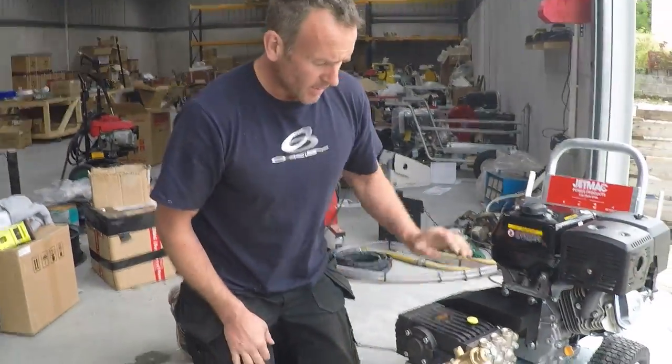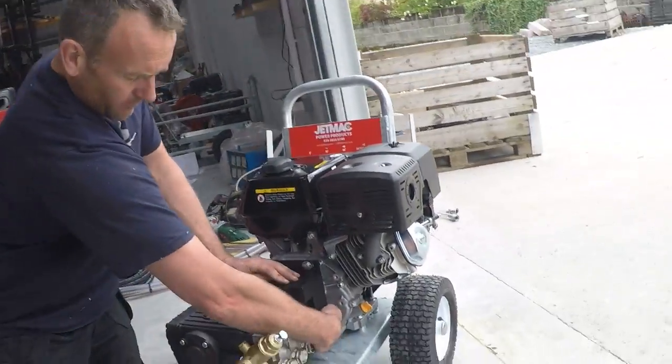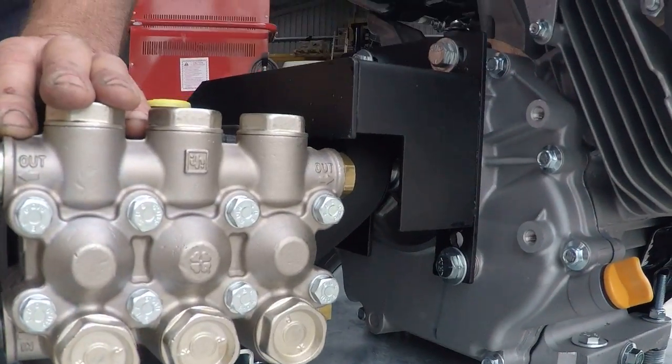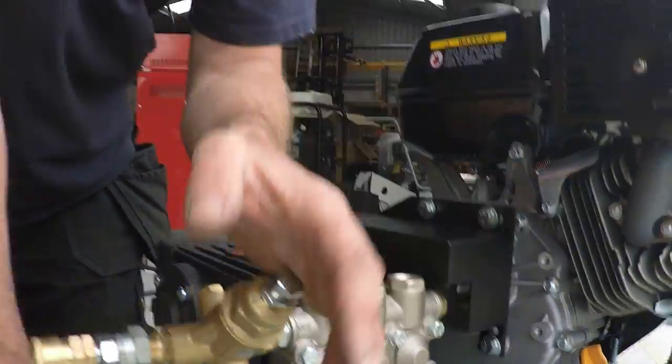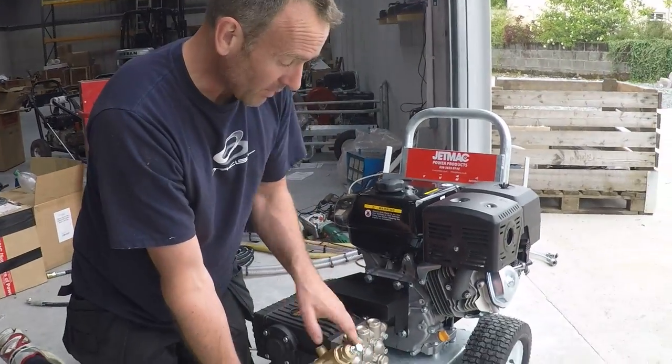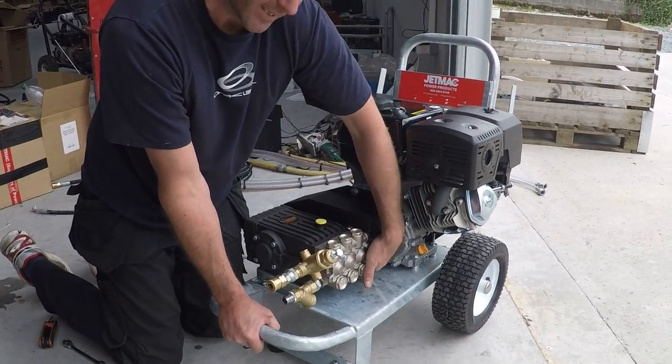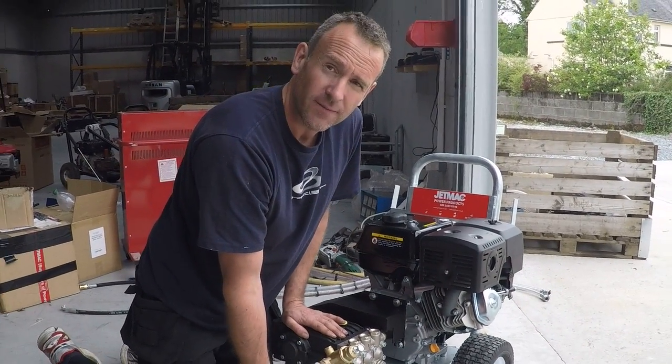And that's it — that's your belt tightened. You'll be able to put your finger in there. Go start your machine and use it for four minutes. When the machine's turned off — make sure the machine's turned off, do not put your finger in there while it's running or your finger won't come out again. Make sure the machine's turned off and you can feel in there it's still tight. And that's all there is to it. Thanks folks.